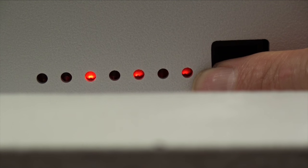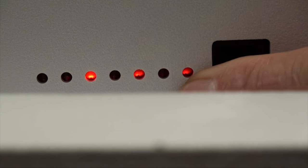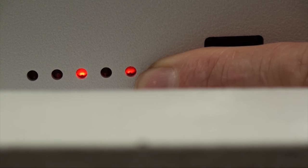That's telling us that we have either a bad motor sensor — and now you can see it's blinking again — or the hand wheel is not in a proper position. So here we can see that we're having a motor sensor problem. Now we're going to identify hole number three, which is our needle position.